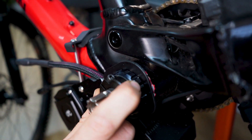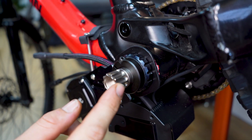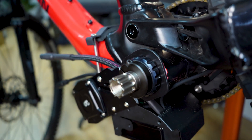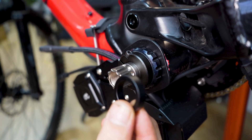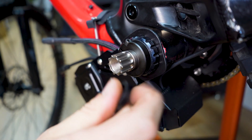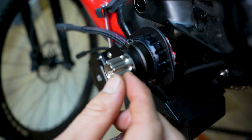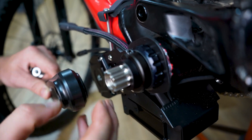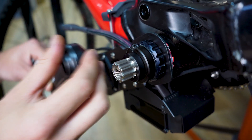After adding the lock ring it's time to add the crank arm. We suggest adding grease on the splines because when the arm is tightened it helps slide the crank into position. You also need to add another spacer which will space the crank up to the marker line. There's an ISIS spec which requires a shoulder for the crank arm to rest on, so when you tighten it to torque spec it will rest on the spacer ensuring the crank arm cannot go loose.